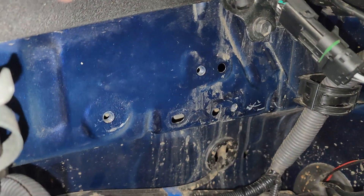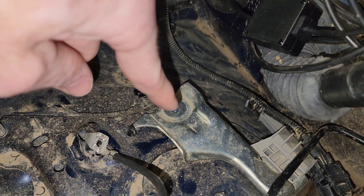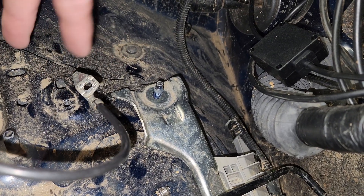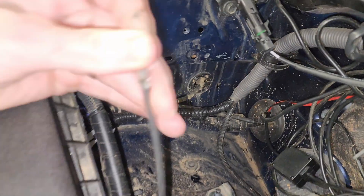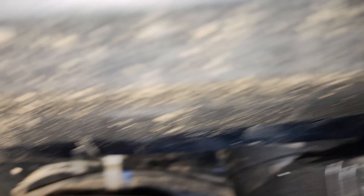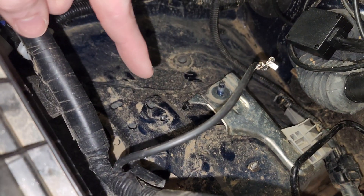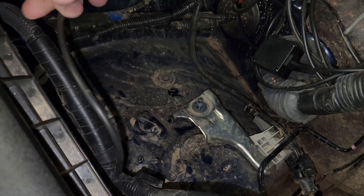I was wrong in the previous clip — it's not that hole and that hole, it's actually this hole and this hole. I've taken that nut loose and the tray will sit on top of that. We're test fitting it. The ground goes right here on the fender, but the tray seemed a little wobbly. What I'm going to do is take that bolt out and then run it up. The battery is going to be grounded to the chassis either here by the airbox, or I'm going to run it up to that ground right there. Either way this ground will have a place to go.